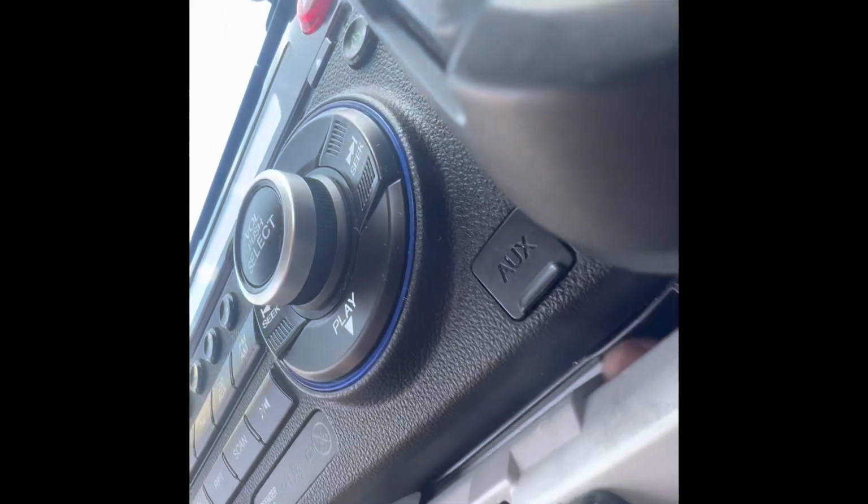Now if you look underneath in here, there is this screw that goes straight into your radio, and while this screw is in place, you will not be able to remove the radio. Also, this is the security peg from the back. I showed you from the front. There is my little finger that showed you from the front that you will have to hold on to be able to push the radio out.